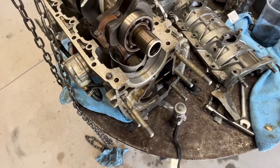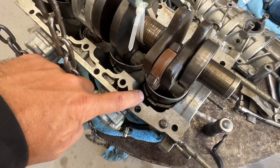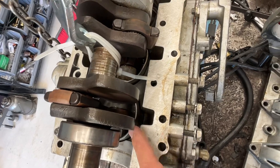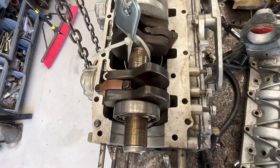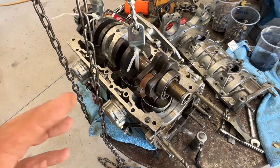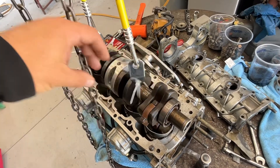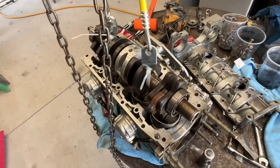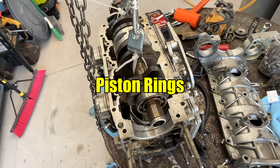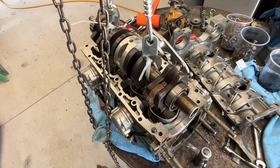The real caveat is the reliefs — you can see there's a little relief here and on the opposite side there's another one. That gives you access. From a factory perspective, Kiekhaefer Mercury made a clamp kit — they look like big C-clamps. You put them in three or four positions and it basically preloads those springs. So unlike a conventional sleeve-type piston ring compressor, it's just like a clamp.